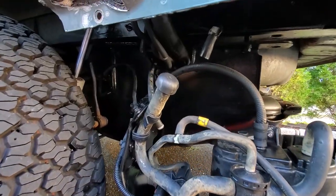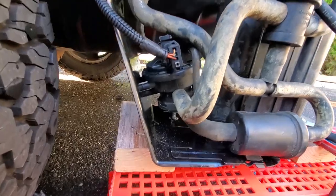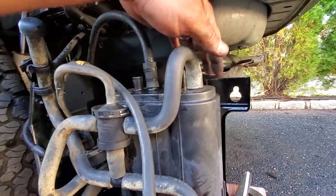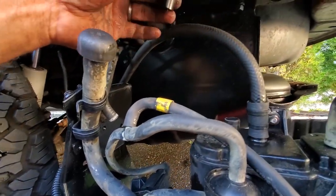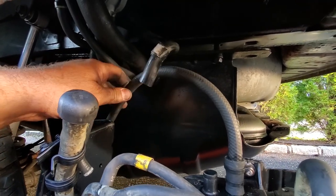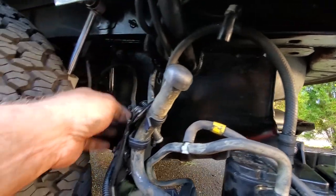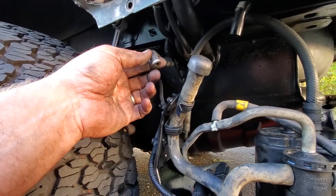I spent the rest of the afternoon scrubbing and cleaning, turning something that looked like an ugly rotten EVAP box into something nice, clean, freshly painted and dry. I reassembled everything together using the new cleaner parts. Now I just gotta connect a couple tubes. This part right here that was majorly split — I'm going to cut it past this little bend and use a splice from the line that came with the other box. Same thing with this elbow — actually, it's a nice tight fit so I'll reattach it right at this tee fitting.